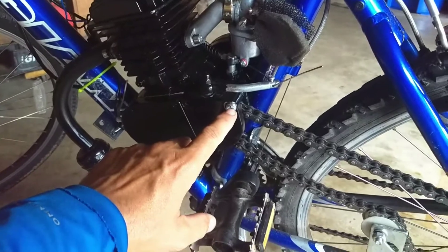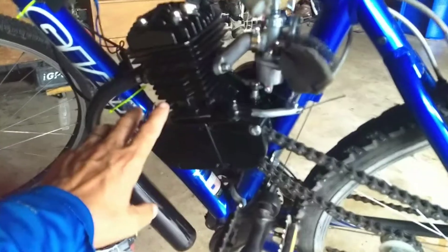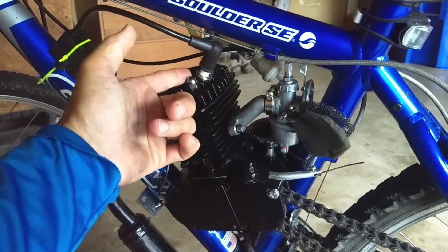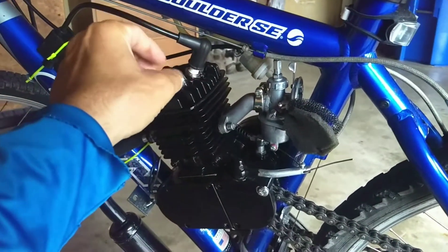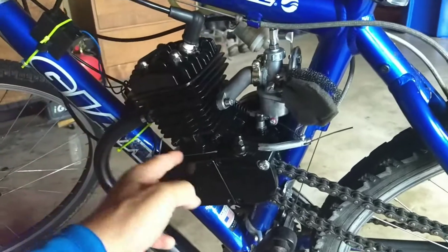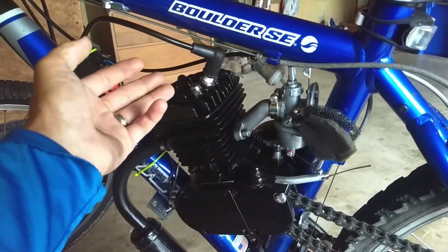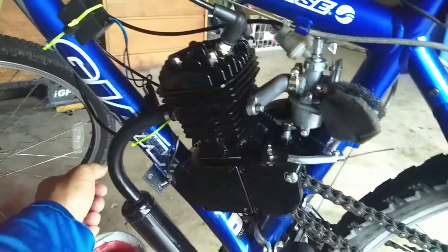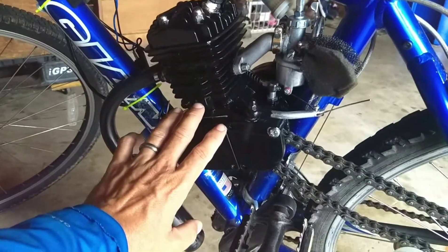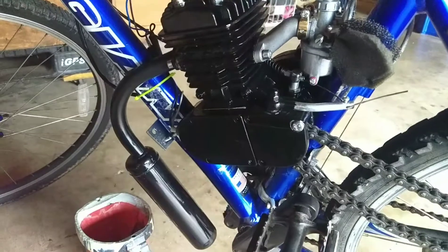I had to go out and get a new screw. They spray painted everything here, so a lot of the fittings were painted over. When I put the spark plug in, down inside the hole it was painted, so it really had to take its time to thread it in. I actually took the engine back out and shook it out because it felt like some of the paint was going down into the cylinder, which could be problematic. The same issue applied to every screw — everything threaded was kind of painted over.